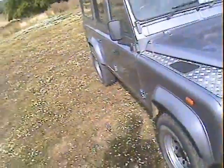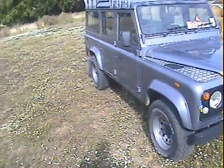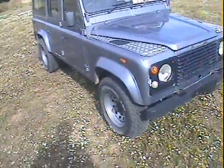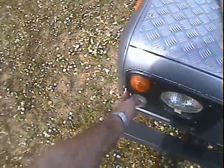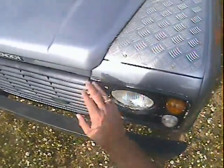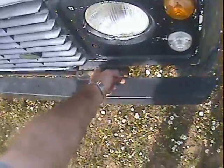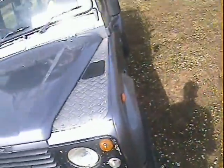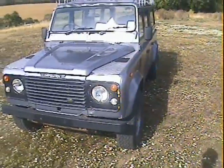Let's go around it and pick out some good bits and bad bits. It's very dent-free, very straight indeed — just a fair few areas of paint loss and electrolytic reaction popping up here and there. Around the front end, the light trims are quite badly pockmarked; a new pair of those wouldn't go amiss — they're only about £12 each. There are a couple of bits of paint loss up this seam and on the bottom of the nearside front panel. Looking down the nearside front wing, it all looks pretty straight and clean by Landy standards.